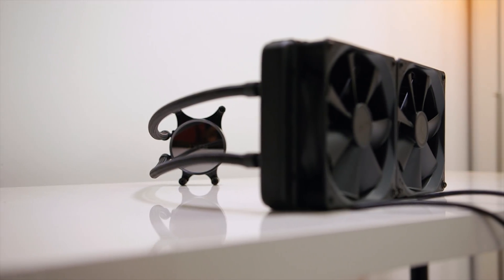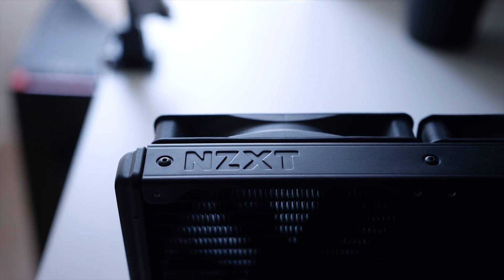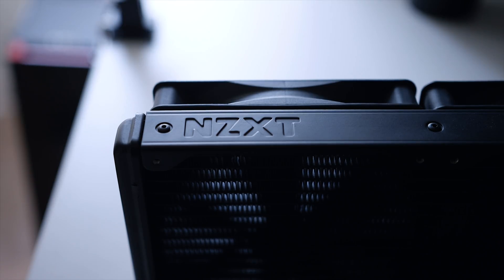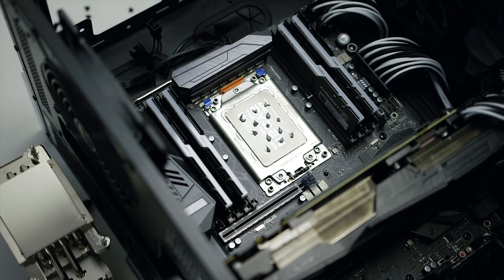On the AIO side, I decided to stick with the X52 and the X62 from NZXT. The X52 features a 240mm radiator while the X62 features a 280mm radiator. Regarding thermal compound application — with Threadripper CPUs it's a bit tricky because of the large CPU die. I decided to stick with the X pattern for the AIO coolers, but Noctua suggests a different technique: apply nine small drops onto the heatspreader in a 3x3 square pattern, then add four larger drops in between.